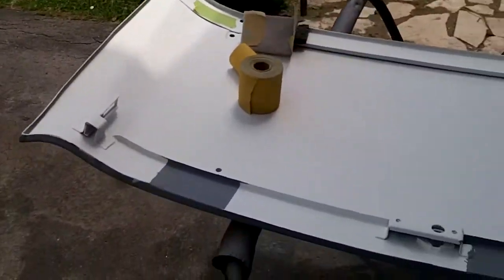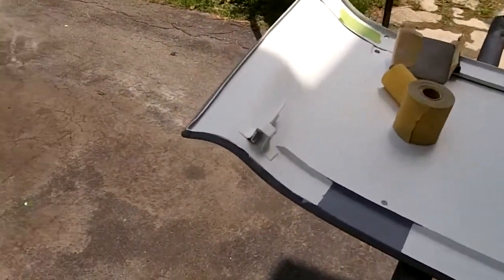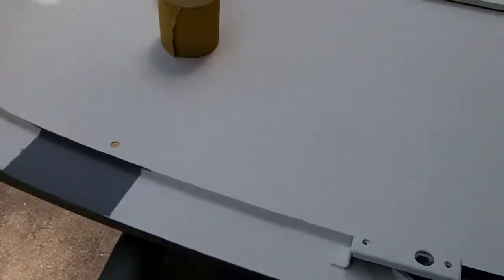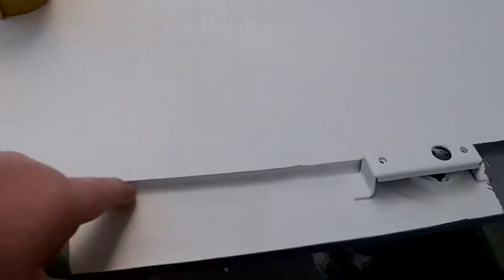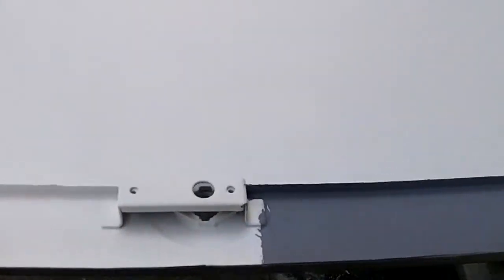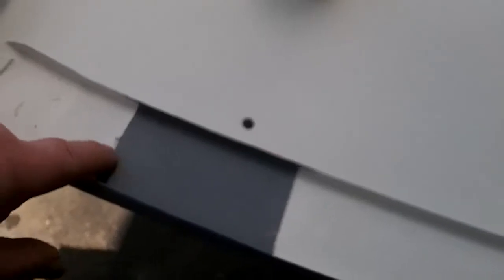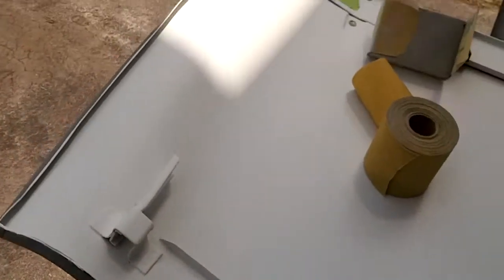We move to outdoors. Since the hood's drying in the garage, we don't want to disturb that for another couple hours. So I brought the trunk lid back outside, just outside the garage doors. Some of you may recall from last year, this was kind of my first attempt at painting and it was a bit of a screw up. I had paint pulling away, actually, in the edges here. So what I've done is I've done a repair section and reprimed it. So what I need to do now is sand this area back down. Plus I also need to sand the base coat from what I painted before down to 400 grit. So what we're going to plan to do is work on this area today, see if we can get that ready for paint, and then maybe later this afternoon we'll be able to get it inside the garage. All right guys, we'll talk to you in a bit.